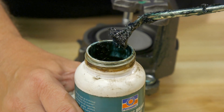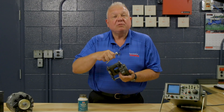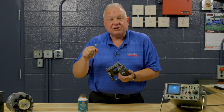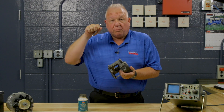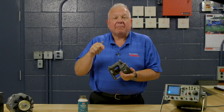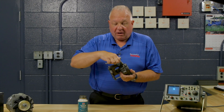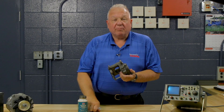What you would do is lubricate the bushing, the o-ring, and then the slide points. Once you do that, all of the hydraulic energy that is created by the master cylinder to push the pad against the rotor will be used to stop the vehicle, and not consumed by the friction of the pin, the bushing, and the bore.